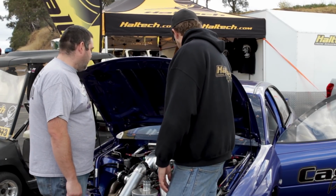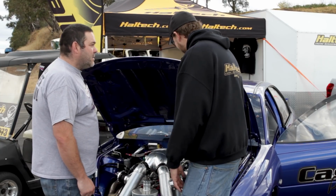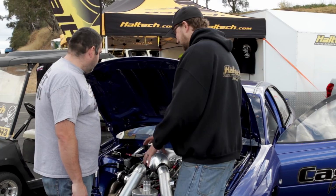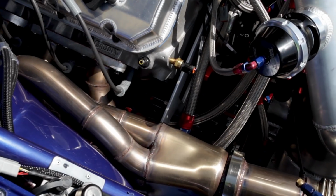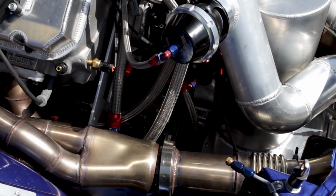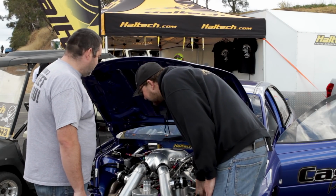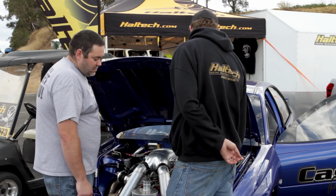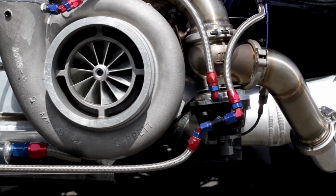All right. Well, the next part that I suppose we really do want to know about is the turbo system. So tell us a bit about the headers and all your expansion pipes and what's going on. Yep, so we made all them in-house. Chris, our fabricator, did all them. They're 2.25-inch primaries into a 3-inch secondary pipe down to the turbos. I love this collector. They look nice on both sides. Nice and simple. It's got a pair of Turbosmart 60mm wastegates and a pair of Garrett turbos.